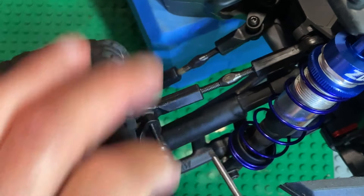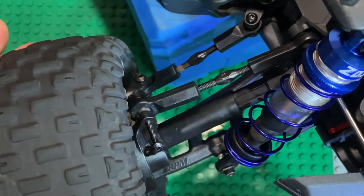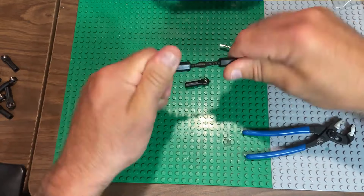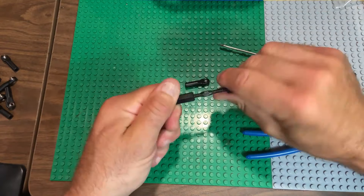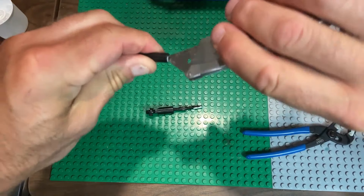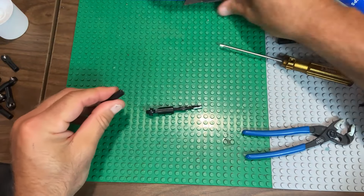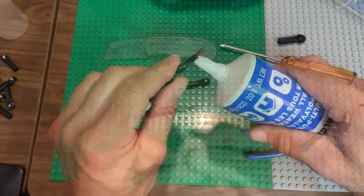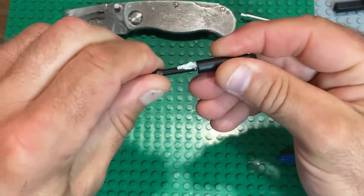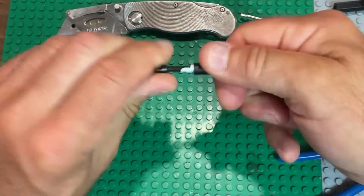This is basically just removing and replacing the stock stuff with new rod ends. I'll start by dismantling and removing — just showing you one side since the other is already complete. Keep in mind when you're messing with turnbuckles you're rarely righty-tighty lefty-loosey. It can be tough to start the thread sometimes, so I bevel the inside of the rod end with a utility knife and add a little grease since you are making your own new threads.